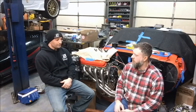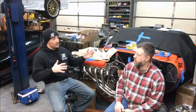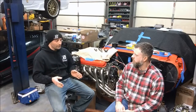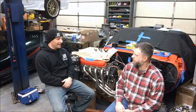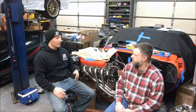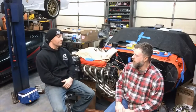You also have LS2s that came in the Pontiac GTO. In 2004, the GTO started with a 5.7 24x motor that looked like a Gen 3. Then in 2005 and 2006, the remainder of production went to the Gen 3.5 / Gen 4 24x LS2, which had a front-mounted cam sensor but ran on the E40 controller — the same controller the Corvette used in 2005.